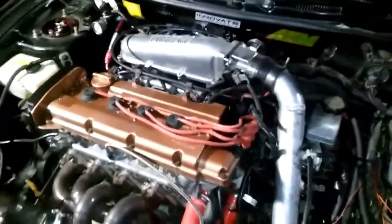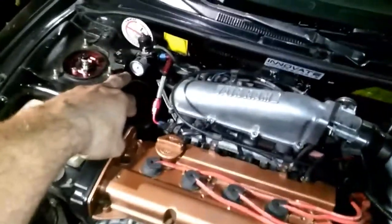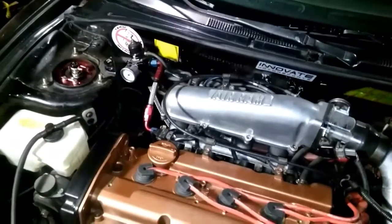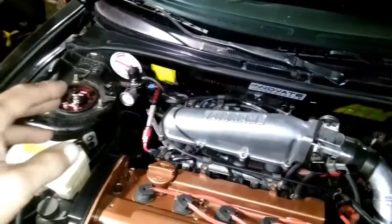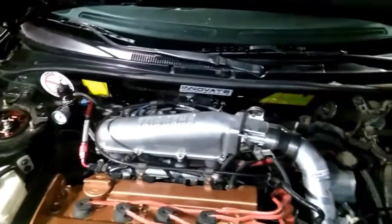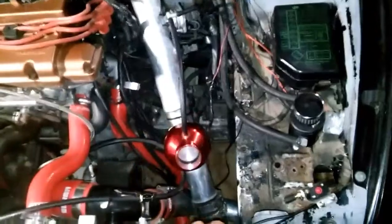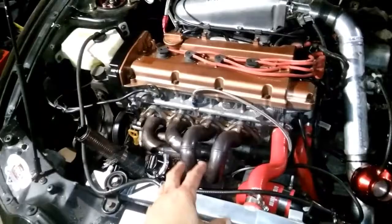I think we said the Aeromotive. I'm not sure if I did or not. Aeromotive adjustable fuel pressure regulator. That's ethanol, methanol, alcohol friendly, so that shouldn't eat out. Yeah, eBay crap intercooler piping down here to there. Want to change that all to a Sheepey. Maybe go top mount. Maybe go forward facing. Thinking forward facing is the way to go for me.